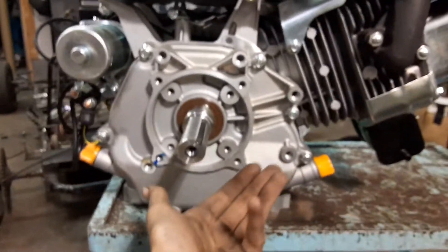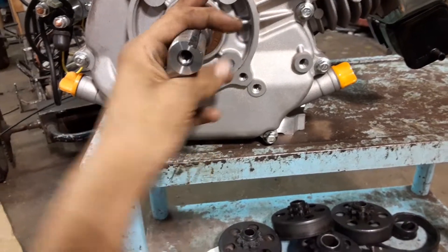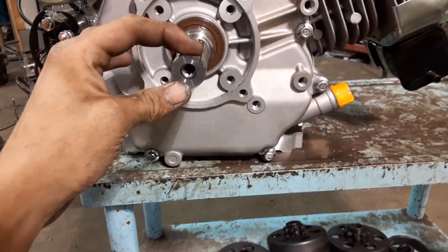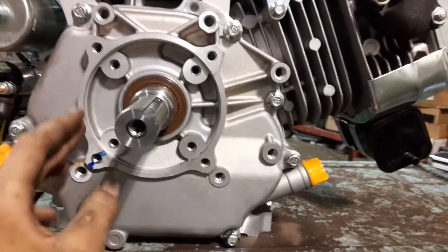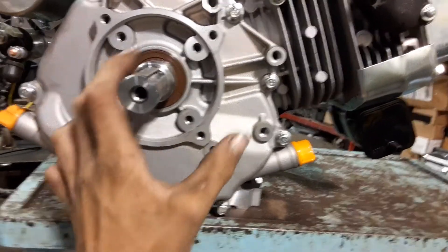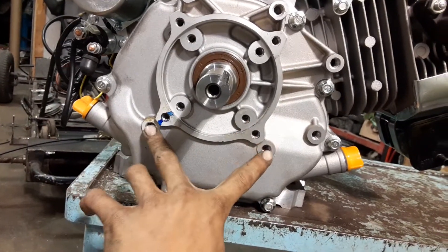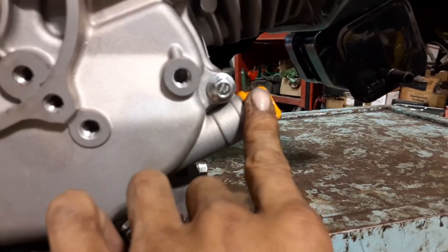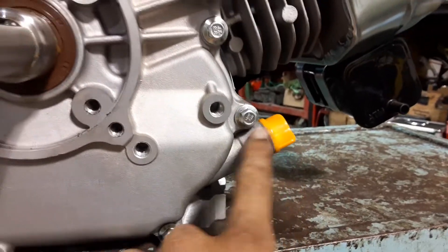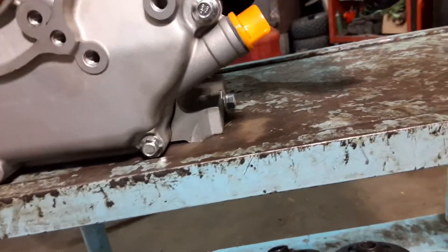This is the side of the engine. The first thing you'll notice is how big this crankshaft is — this is a one-inch bore crankshaft, so the diameter is one inch, compared to the Predator 212 which has a three-quarter-inch crankshaft. There are multiple different bolt patterns for whatever you want to bolt to it: a standard Predator 212-style bolt pattern, a bigger one, and an even bigger one right here. You also have two oil fill locations — one on the front and one on the back of the motor — and an oil drain plug on both front and back as well.